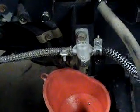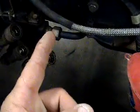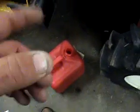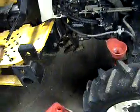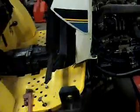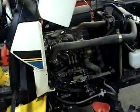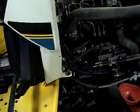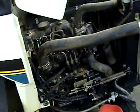And the next step in this whole deal is to crawl underneath on the creeper, remove the drain plug, and drain the oil out. Now before I do that, that's what this gas can's for here. I've got a couple of them that the spouts are bad on. Make sure it's clean. I'll put a funnel in it, catch all the oil in there. That way it makes it a lot easier to put the oil back into the motor, because yes, I am reusing this oil. Because as y'all seen from the last videos, the last time I tore this thing down, damn fly, big old sucker too. This thing maybe had 30 minutes runtime on it before we noticed it was going to need pistons, which I knew all along. But the oil's still good, the antifreeze was good, so I'm going to reuse both the oil